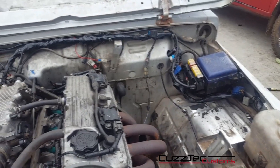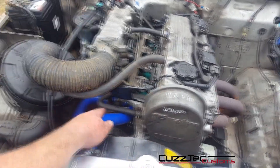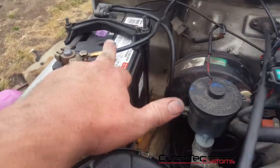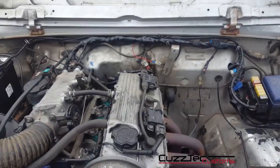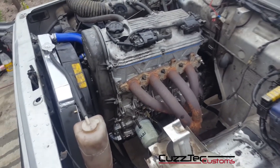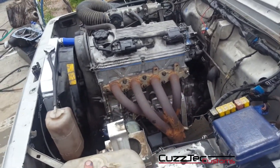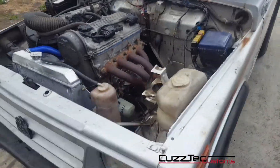Wiring done. We just took it for its first drive and all went well — forgot how hard stock cars with G6 engines actually go. So I'll show you the wiring: nice and clean down on the inlet, that's your feed for your fuse box across. There's a little bit of wiring going on there but you can't tell it's there. It only stands out because the rest of the engine bay is filthy and that section is clean. Pretty stoked with it. There were a few things we couldn't do — we were going to put in an aftermarket oil pressure and water temp gauge but the thread in the block was different and the water temp sender leaks.